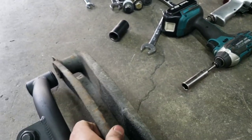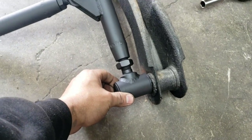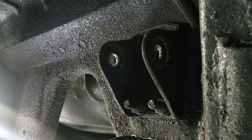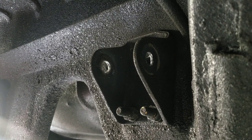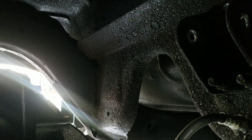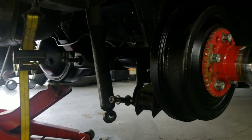On the banana bar, this side was connected to the rear end and that side to the frame. It is the same width or length, and it is adjustable down here so you can correct your pinion. One thing to note: if you have shims behind this bracket, we recommend taking those out. Our y-bone is designed to eliminate the shims so it sits straight. On the opposite side there's a little hump — that's the platform where you'll put your secondary bracket.